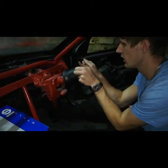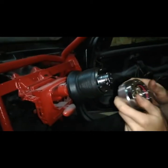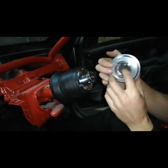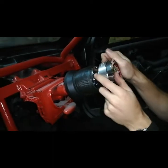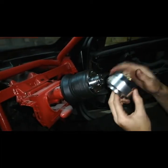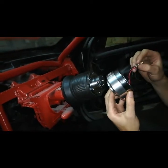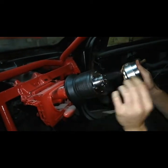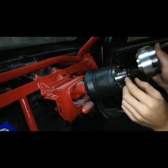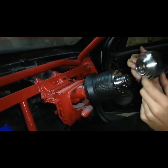Some people have asked how the hooter works if you take out the quick release. There's a positive and a negative, and when you fit it - like I said it fits only one way - as soon as you press the hooter on this side, those two bolts make the positive and negative connect, and then the electricity will go through it all the way to your hooter.